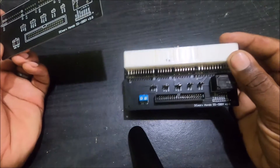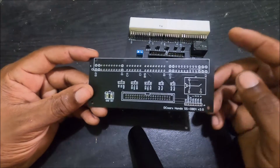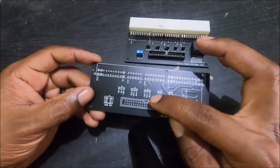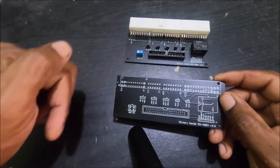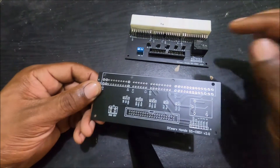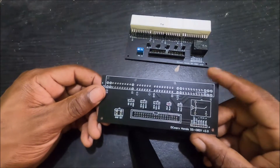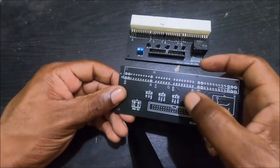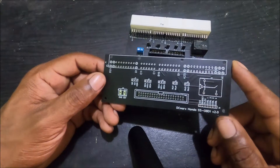When fully assembled the board will look something like this. You'll be receiving this board with the connector, which goes here, and also the IDC connector. The slot cutout has this piece going to the top. You'll also receive a two-screw terminal connector, which goes here with the wire receptacles going out. The relay goes here, and you'll also be receiving a 10-pack of pin headers. The pin headers go in here — you need to break them apart and place three here, three here, and two and two respectively.